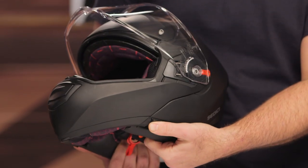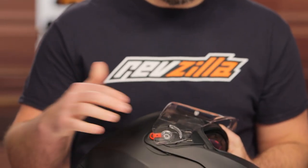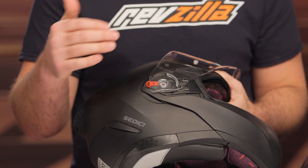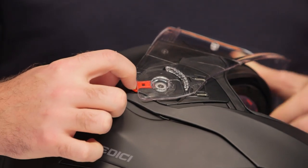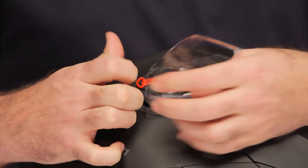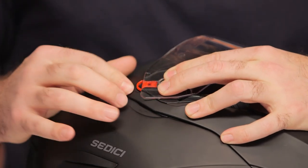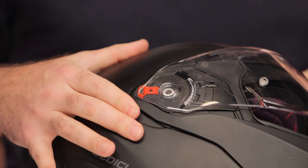Let me show you what I'm doing here. We have the internal sun visor, which is down — it actuates on the left-hand side; push it forward and it goes back up. The face shield compared to the previous version with that pod is 100% easier and less clunky, and you don't have to worry about that pod falling off. It's still going to require two hands. You have a little red tab on the back: put your finger in there, pull the tab backwards, and then pull the face shield out. To get it back in, line it up, pull that tab back, and it slides right into place. Open and close it a few times to make sure it stays in.